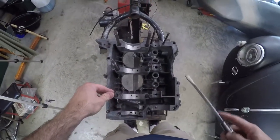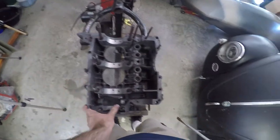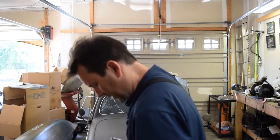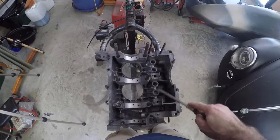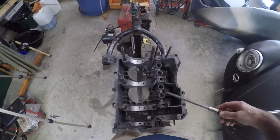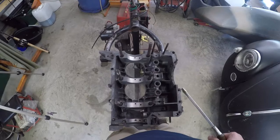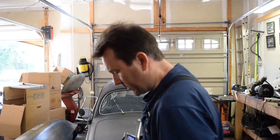Back from the machine shop, you can see there's a nice line bore here. It's going to need a little fine cleaning — we'll do that before the final assembly. We'll also check these lifter bores with the camshaft in there and make sure we have a good amount of clearance between the top of the lifter and the cam, so you don't wind up wiping out the cam.